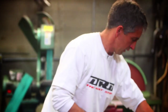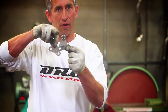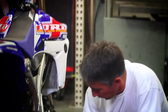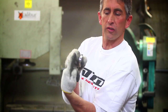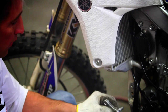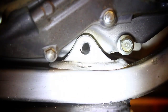Now I take the front bolts and plates provided in the kit and install the front plates. You could spend 20 minutes filing these out two and a half millimeters yourself, but we've already done that work — the bolt holes are already aligned properly. Make sure you include the clips; these go on the back side with the engine side facing in and the bolt side out. Run your bolt through and back through the engine, and you can see the engine has moved forward two and a half millimeters.